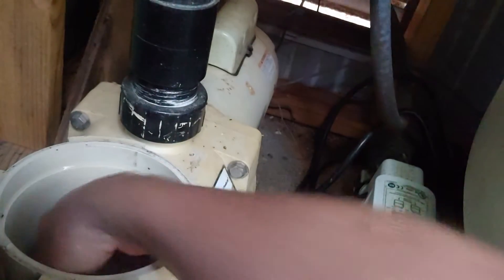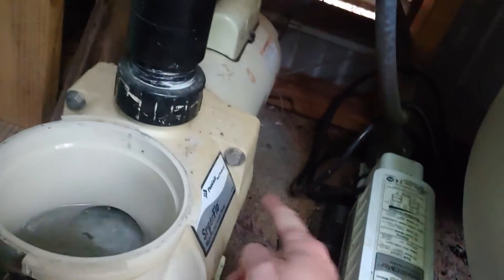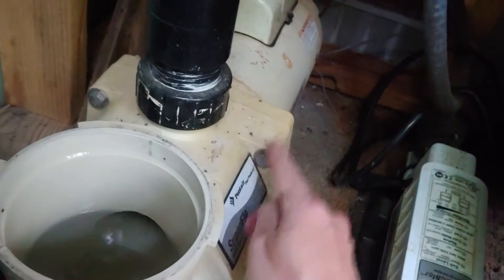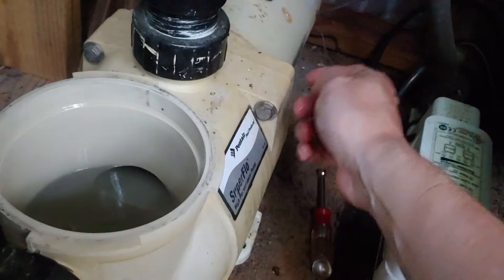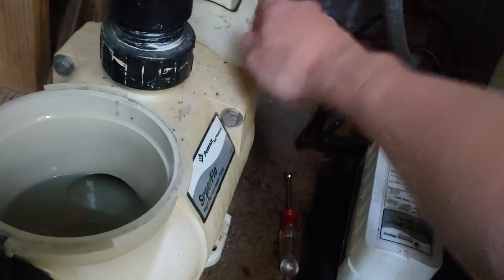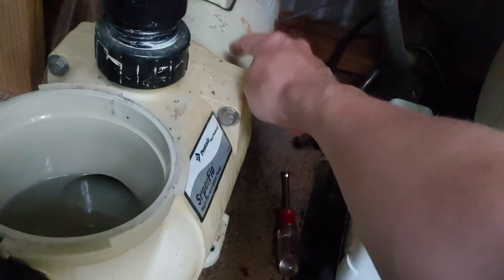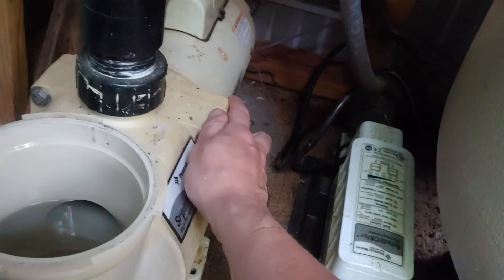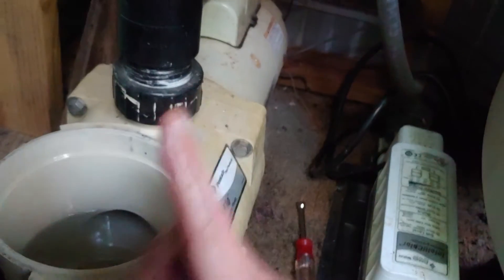If it's stuck and you can't spin anything, you may want to take this apart. With all power off, take the motor off and turn the motor shaft itself or the impeller — whichever you can reach depending on your model. Check that, because a lot of times that will fix your motor and you'll be back in business.